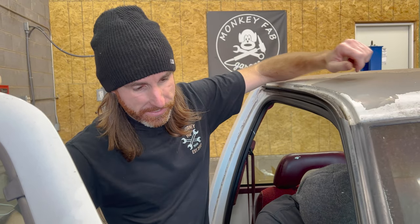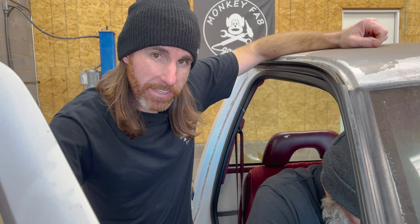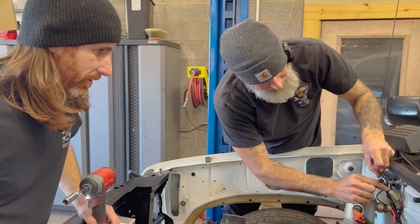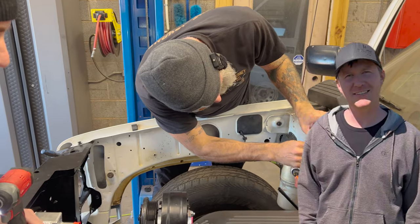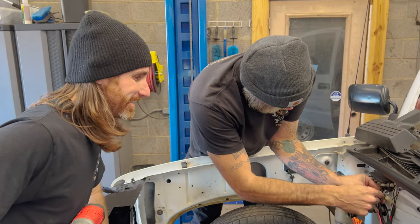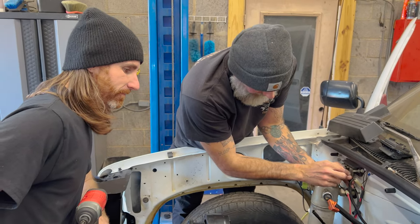The update is, it's not getting power somewhere. So no cranking. We ain't got gas, we don't have power. So Russell's chasing down wiring problems. He figured it out. I just had to call the smartest man I know when it comes to this stuff, and he told me what an idiot I am. And now we've got it figured out. We were grounding power wires, so that didn't work. They don't get any power when you do it like that.